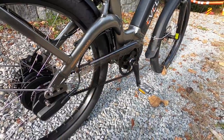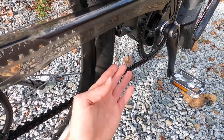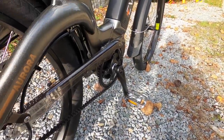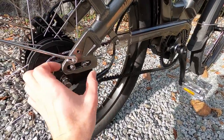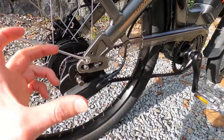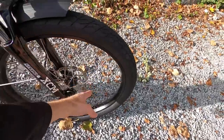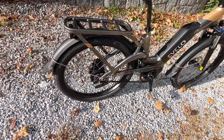22 tooth back here, 55 up there. This is a Gates carbon belt drive, so it has the center track — it's not gonna slip side to side. I haven't had any problem with these. Apparently they last longer than chains, very durable. Because they have this unique mono tube, they've got this horizontal sliding dropout. If you loosen these nuts, it just drops down — the axle just drops right down — making it easier to service the rear wheel. Thicker 13 gauge spokes, 36 hole rims, 45mm wide. They're really doing this thing right.